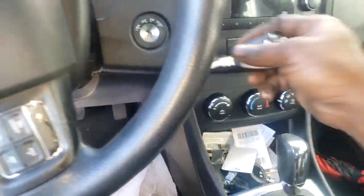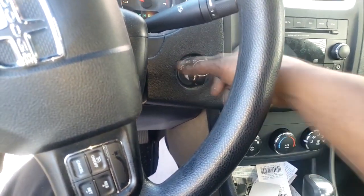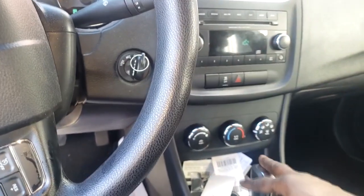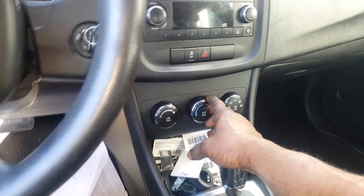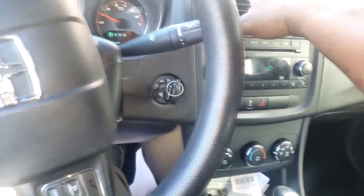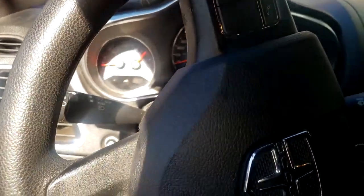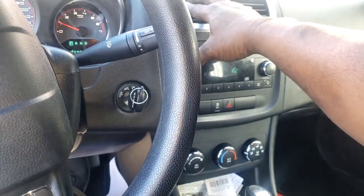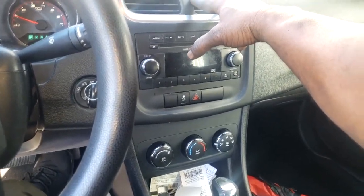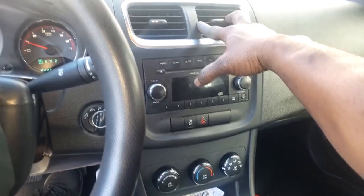Alright guys, I have the restriction removed. If there was any restriction, there's no longer a restriction in the heater core. I got it properly bled — no air pockets. Let's see what we got. I'm in full heat. As this car warms up, that heater should get extremely hot. It's hot right now, guys. I didn't want to say successful repair too fast, but it's all about restrictions — it doesn't take much to restrict a heater core.